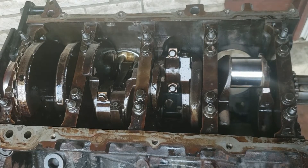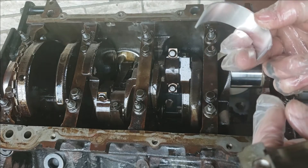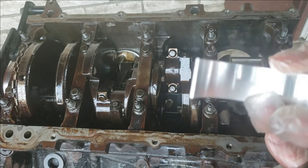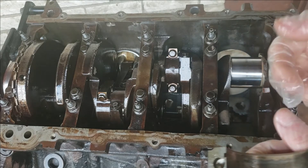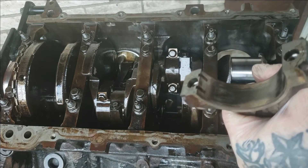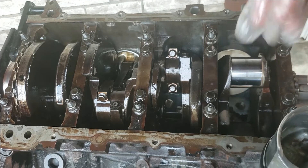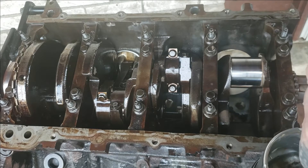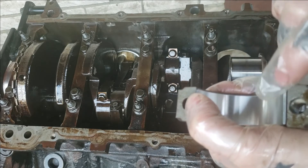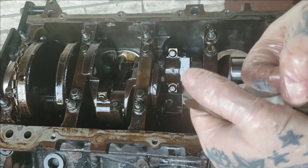Your new bearings on these rods — on this LS it doesn't matter which end is top or bottom, they're both the same. Spray them off with brake clean and clean them because sometimes they got oil and dirt on them. Before you install them, also clean the bore for your oil — keep it nice and dry. You don't want oil under that. Now you can plastigauge your bearings; I marked mine and mine's within spec of the bearings I took out and this motor ran, so pretty much I say everything's good to go. These just snap in — make sure all edges are level.